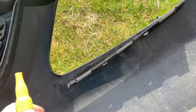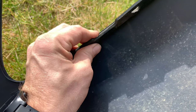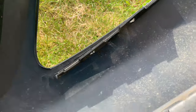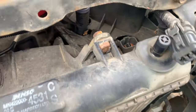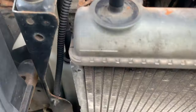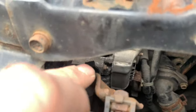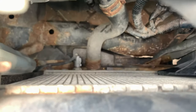Yeah, a little bit better than I was thinking. The fan plug is on the right hand side, just at the back of the fan. Once you're taking the brackets off — rusty 12mm bolts — pull it forward a little bit and you can get down to that easy enough. There's also a wiring plug on this side which you need to take out, plus this expansion tank hose clipped in there. You need to get that hose off, and then there's a hose at the bottom. Down there is also the fan switch temperature switch for the fan. That's pretty much everything and then just lift out the front.